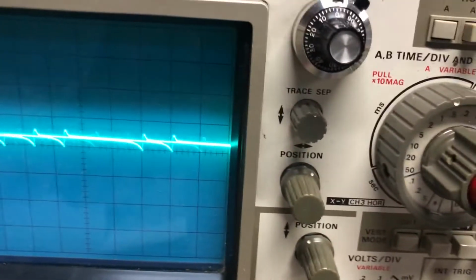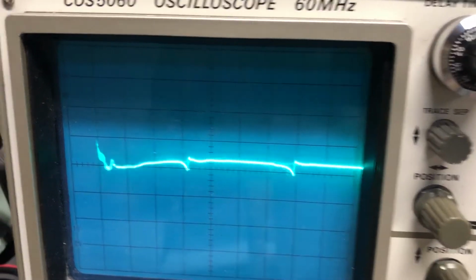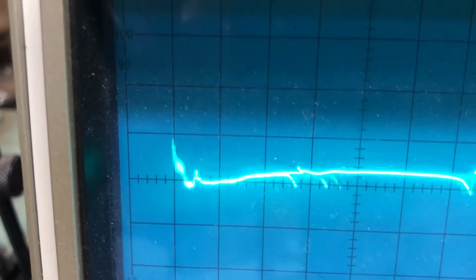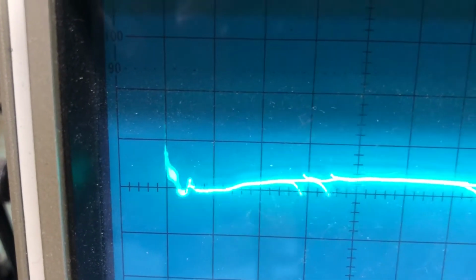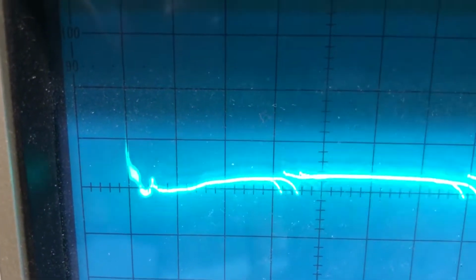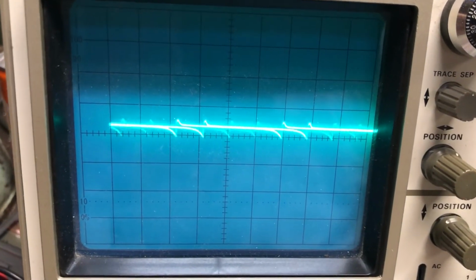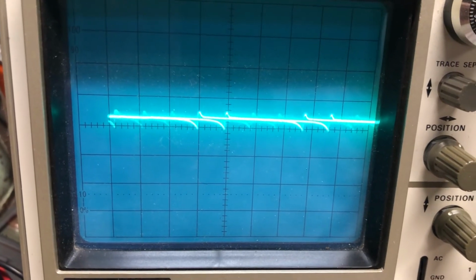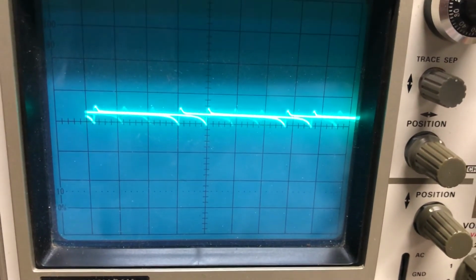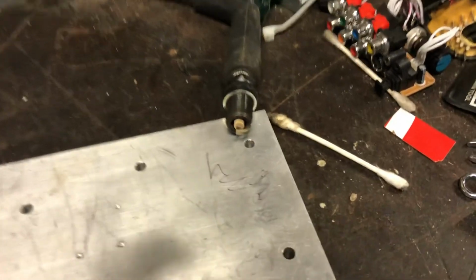Anyway, but when you do run the points, you do get that spike right there. And that's actually 5, 6, maybe 7 volts higher than even the biased 12 volts. So again, that's working, and that does have the same behavior as just across the resistor, or just across line 1, just that everything's biased 12 volts. So that all makes sense. Yeah, one more time for the spike.